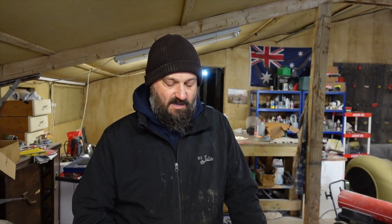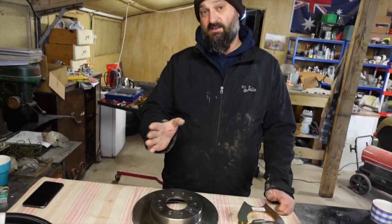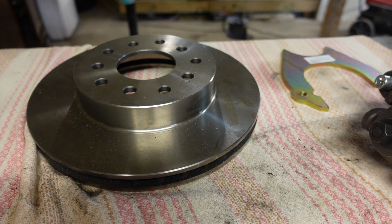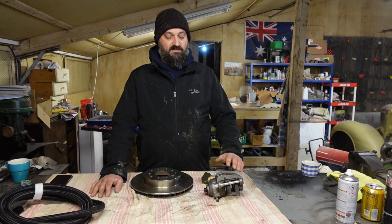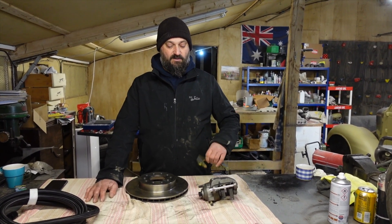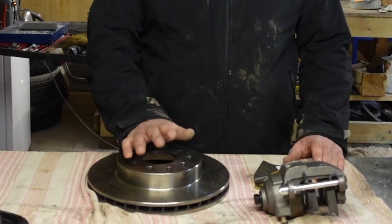So I phoned a mate of mine, Mark — Mark Tony — he builds lots of rear ends and he has 3 different disc brake kits for it. We were hoping that the offset on these discs would bring the brakes out past the chassis rail, which is exactly what happened. They're just a GM disc and caliper, not sure exactly what they're off. I just re-drilled the stud pattern because we've got big Strange axles. The centre's quite large so I've machined the centres of these out to slide over the axle. Just a Speedway caliper — it sits outside the rail now, which is absolutely fantastic. The bracket sits literally between the spring perch and the U-bolt, but it doesn't foul on anything and you can still get everything in and out with ease.